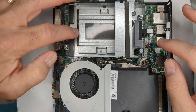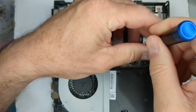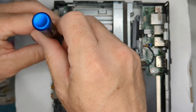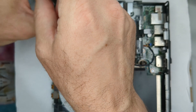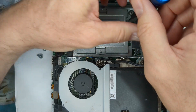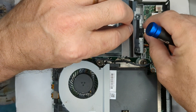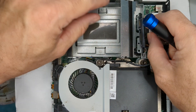To get to more of the innards, let's remove the drive cage using a T15 Torx. These two screws are shorter ones, and then there are three longer ones plus one down here. If you have a 65-watt unit, this is going to look a little different — this particular piece will be missing and instead there's going to be a fan here, and you're going to need to disconnect the fan from the motherboard. The fan connector is over here, in order to be able to get out the drive cage.